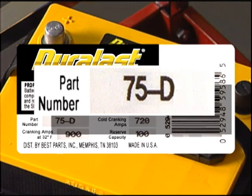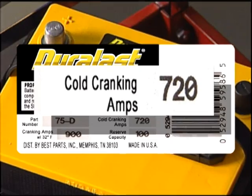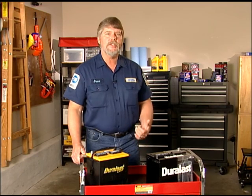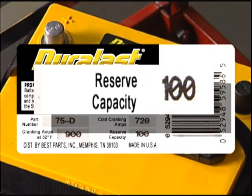For instance, the part number of this battery is 75D — the number 75 is the group size. The CCA rating is critical for good cranking ability. As the outside temperature falls, the engine takes more power to start due to metal contraction and the oil getting thicker, while at the same time cold temperature decreases the battery's efficiency. The RC helps power the electrical system if the alternator fails. The rating indicates the battery's staying power — in other words, how many minutes the battery can supply ample power without falling below the minimum voltage needed to run your vehicle.